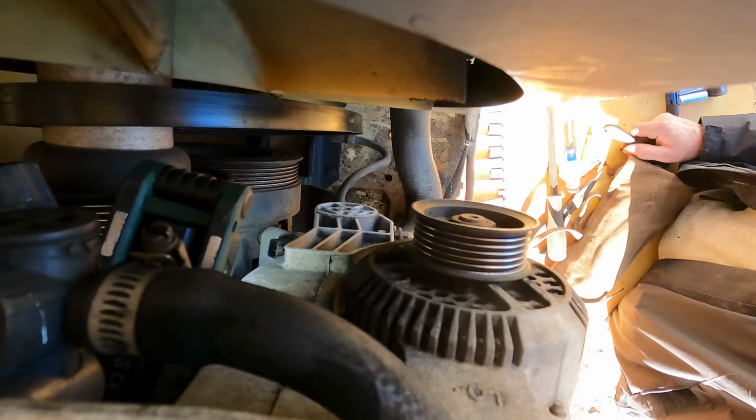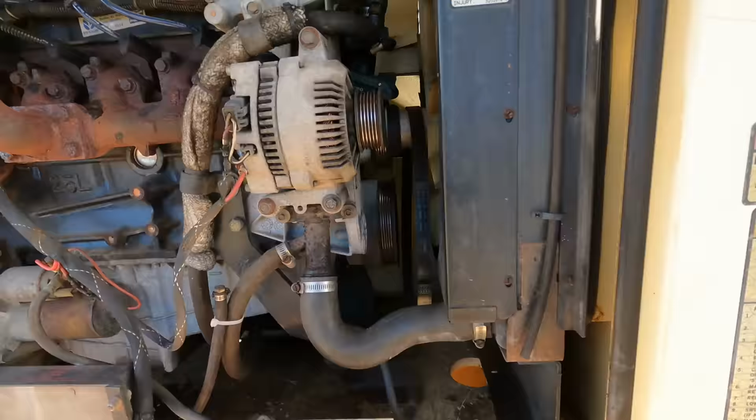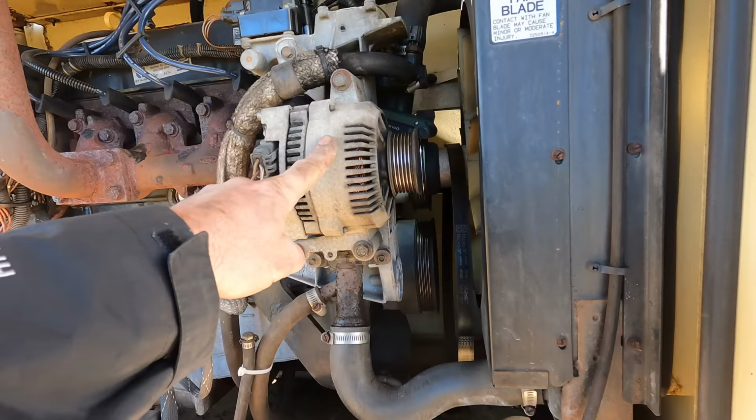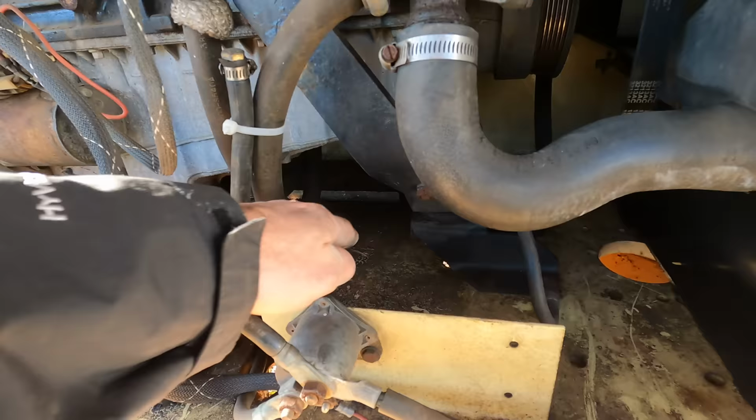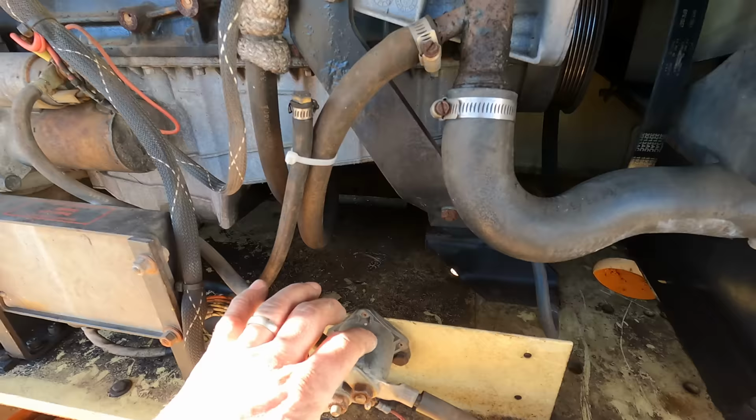All right, I think I need to start taking things apart. So alternator's easy. Let me pop that off of there. Then this entire bracket, not a big deal, except the coolant is running through it. But, you know, I can still probably shift it out of the way, but it's also attached to this, which is the engine mount. So I'm going to need to get up underneath here and support the engine. I'll then undo one bolt.